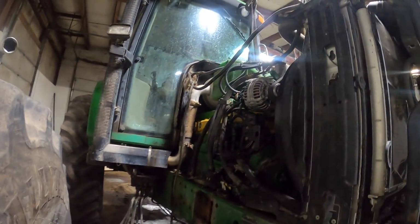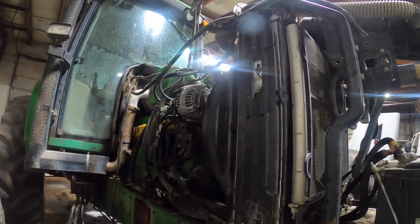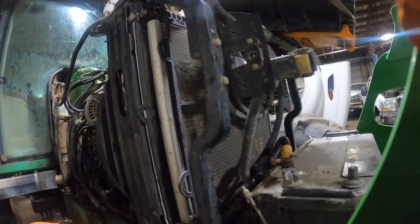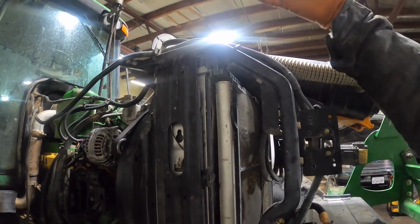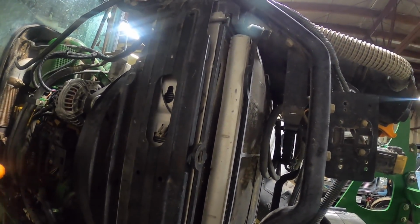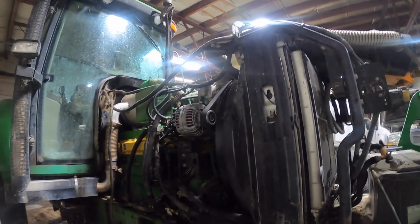When you get that style, you have to be persistent and bleed the air out of that coolant system, because that little pump circulates the water back to the transmission cooler. You'll open the top up and see that the water's not circulating in there once it gets warmed up. If the water in that small section isn't circulating, then it's air pocketed. About the only way to do it is pop the hose off, rev up wide open throttle, crack that hose loose and let it shoot the air out. It'll make a mess, then stick it back on. That's the only way I've been able to get them to do that.